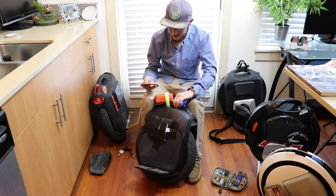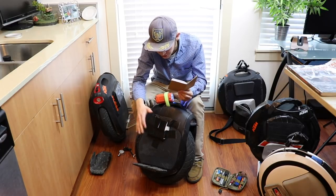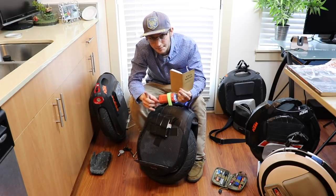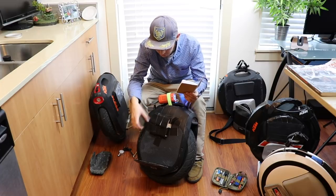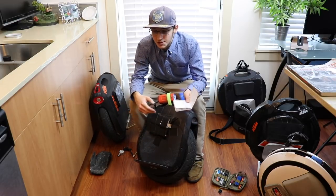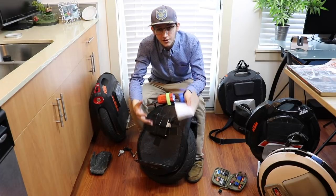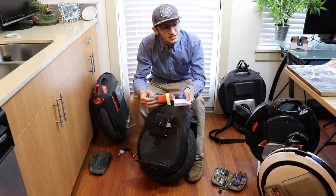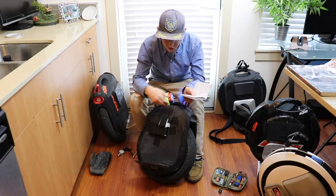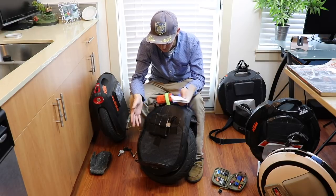For my range test, it said 52 miles, but with my low tire pressure there's so much more friction on the ground. It would have been nice to pump the tire up for range on the bike path coming home, then deflate it for off-road jumps. Some type of little pump would be a really good idea with this wheel so you can vary it for range or off-roading.